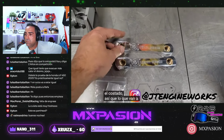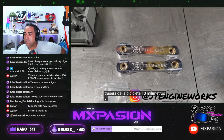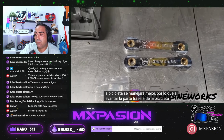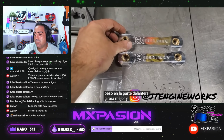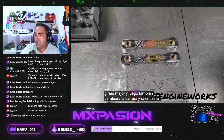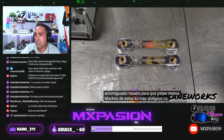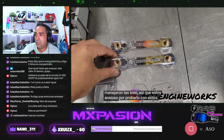So what they're going to do is raise the back of the bike 10 millimeters, and by doing so, the bike is going to handle better. Raising the back of the bike puts more weight on the front, so it's going to turn better. It's also going to change the stroke and slow down the rear shock so it kicks less. A lot of these older KXs didn't handle so great, so I'm looking forward to testing it with these dog bones on here.